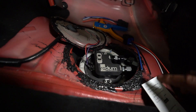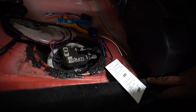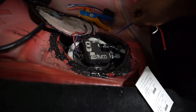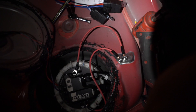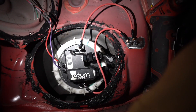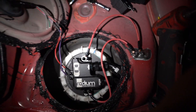Basically I'll need to ask Kevin, but it'll go from here to the relay to the chassis. It's dark in here, but I got my ground wires hooked up for the fuel pumps. All I have to do is wait for my wires so I can run from the ECU back here and from the battery back here, and then I'll be able to prime the fuel pumps and see if everything works properly. We'll do that on Thursday. We're making progress — it's going good, I can't complain. We're almost there.